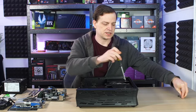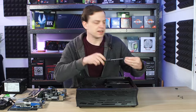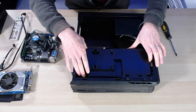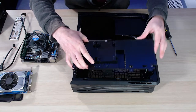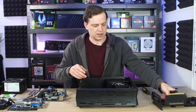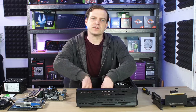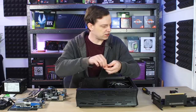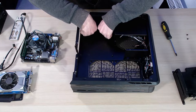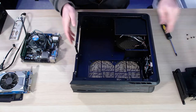We have weighed up our power supply to this case before, and we can see that what you really want for this kind of case is a modular power supply because there are so many extra cables you need to try to hide. With no basement to tuck them away it's probably going to look a little bit of a mess once we've finished. The first thing we do need to install is the power supply because that is actually going to cause us the biggest trouble if we try to do it later, so we need to take this base out — it screws in from the other side — and it is a little bit of a pain to get lined up again.